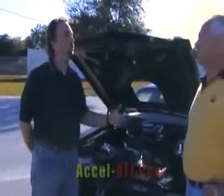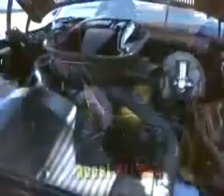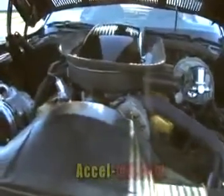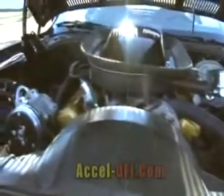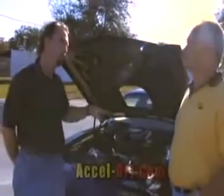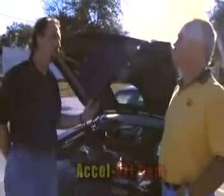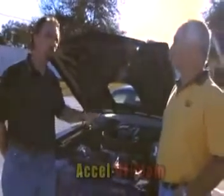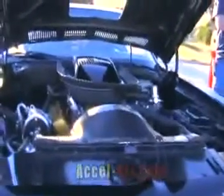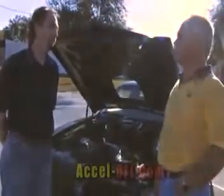This particular car is running something a little unusual: a 2.41 rear gear, a 700R4 transmission with lockup, and a Pontiac 400 with custom aftermarket aluminum cylinder heads. The challenge is how this thing is going to go down the road at 1,500 RPM at 70 miles an hour without total tunability. Their desire was to find a system that would give them low-end torque, tuning capability, upper-end high performance, and steady cruising capacity with minute adjustments. Now they have total drivetrain control — the torque converter, the electric cooling fans, the air conditioning system — it's a complete package for modern muscle in a vintage machine. With a 2.41 gear it's not exactly a neck snapper, but it will blow the back tires off. There's no bogging, no stalling — it gets it done and cruises down the highway like a kitten.